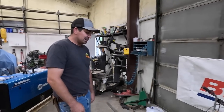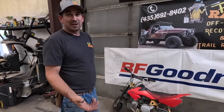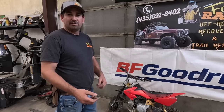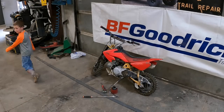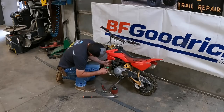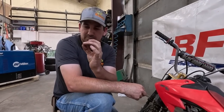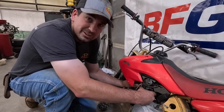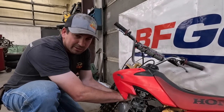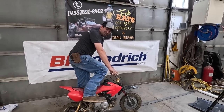My brother is going to bring a leak down tester and help us decide when he gets back. So I went home since we're waiting and grabbed the bike - the carburetor is just junk. I just have to take it off and clean the jet. It ran and then sat for a while. I'll hurry and pull that carburetor off. You can see it's pretty green - jets are plugged, barely see through them. I'll clean the jets out. Main jet was clear-plugged. Going back together - it should have spark and we'll see how this goes. First kick!